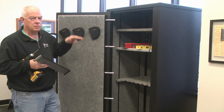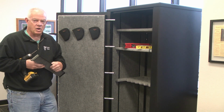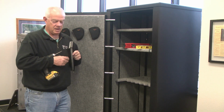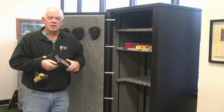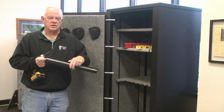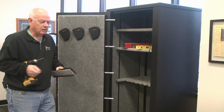The bottom tray is basically exactly the same, with the exception of there'll be a few, 2 or 3, mounting screws that are holding the carpeted door panel to the back of the door. Remove those and discard those, because I like to line up the bottom edge of the tray with the bottom edge of the carpeted door panel to position it. And the 2 mounting screws for the tabs are more than sufficient to hold the tray and to hold the bottom of that door panel in place.